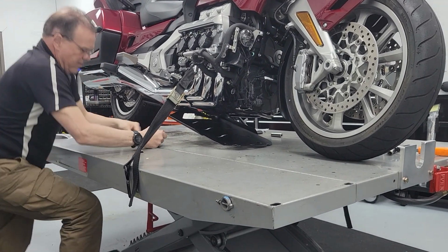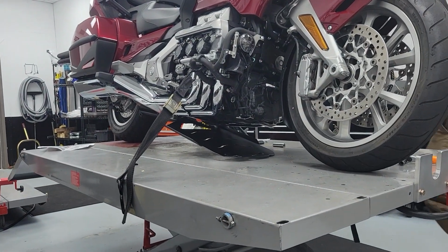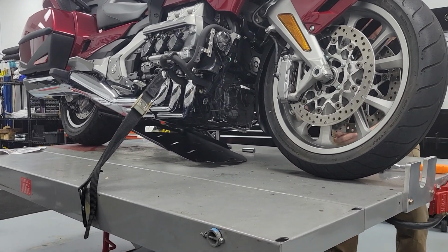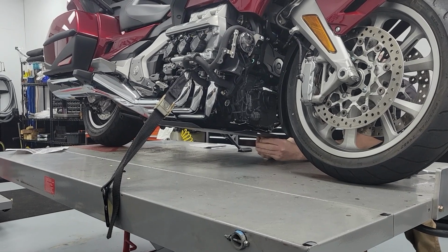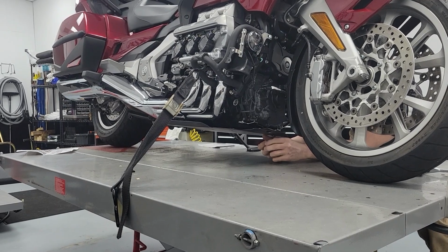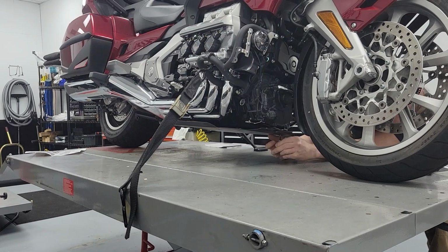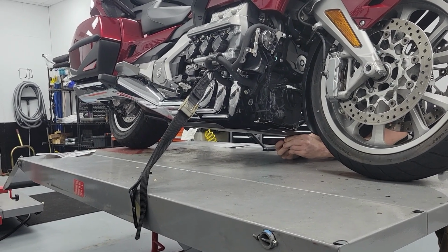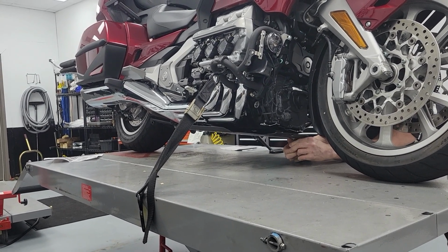So you're just going to start that there. The front only has 2 bolts, or 2 screws, that hold it on. They are the same style screw as the traction engine guard. This one, instead of threading the bracket, since it looks like about a 60 thousandths or 1.5 millimeter thick piece of stainless steel, they've used well nuts, stainless steel well nuts.